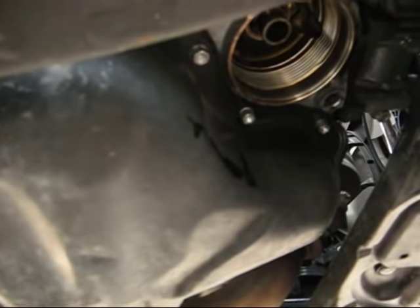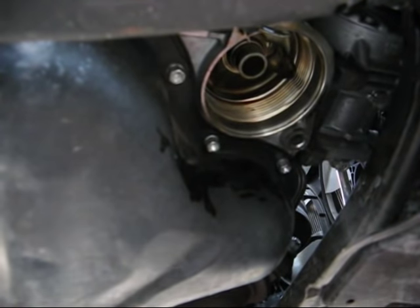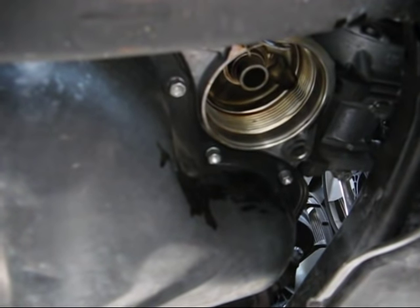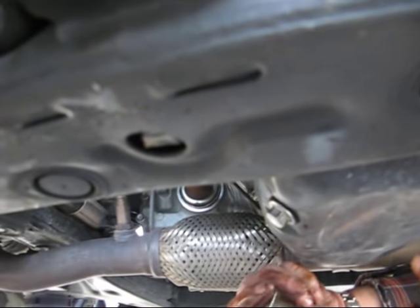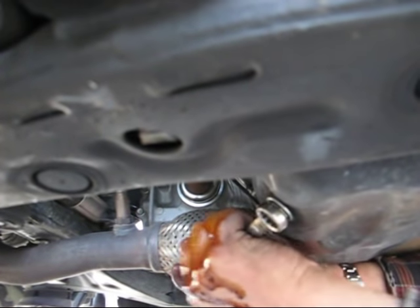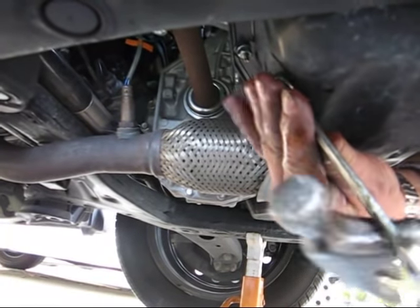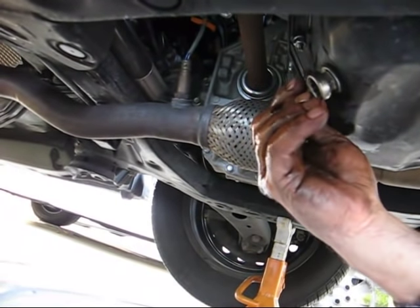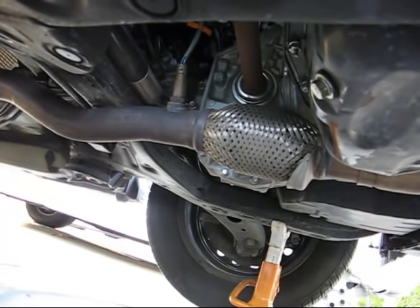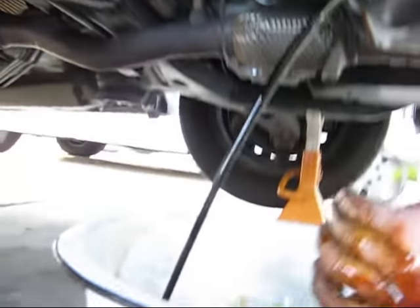I'm going to go back up, clean this off, and show you how all this fits. In the meantime, just let this drip down a little bit. Here's where it goes — it just screws right in, so I'm just going to clean this out, wipe it all nice and clean. Now for the oil pan drain plug itself, this is a number 14, and I didn't tighten it up too badly so I'll be able to get it off. Once you break it loose it comes off pretty easy — have your pan ready — and there you go. We'll just wait for that to drain out.